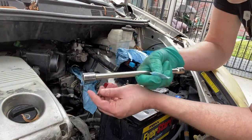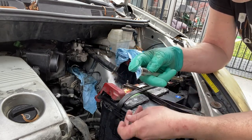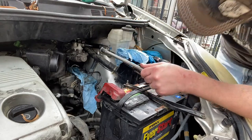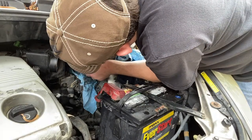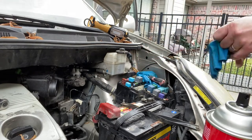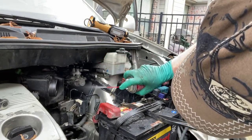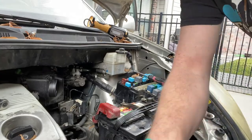I'm going to use a little trick here because I'm reaching so far back and I've already dropped one nut. A little bit of paper towel placed over the top of the socket, then place the nut in there — it's actually going to hold the nut from falling out of your socket. People like me drop things, so I just reach back there and get it started. Go ahead and spray the brake cleaner back up in here to clean off any residual brake fluid that may have leaked out. We'll let that air off and put all this air intake stuff back on.